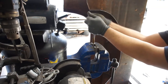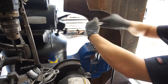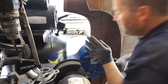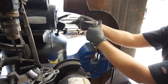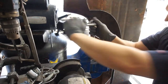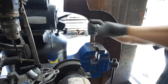It's nine-sixteenths by 18 thread pattern pitch. Just running this in because these are pretty jacked up. I tried looking for some acorn-style lug nuts and I really couldn't find anything online like these — they're Gorilla brand. Get some threads out of there, just going to keep chasing it. One of these wasn't that bad; I'm thinking this one was the worst one, so I'll probably have to chase all the way down.